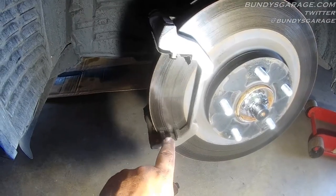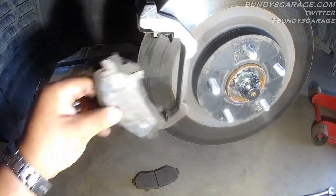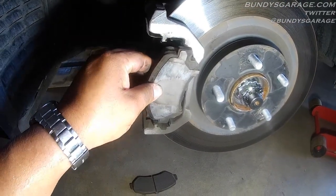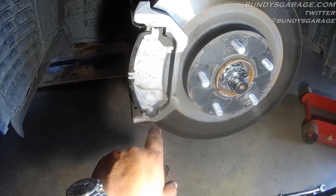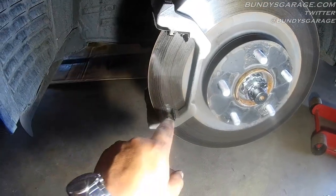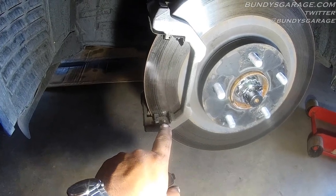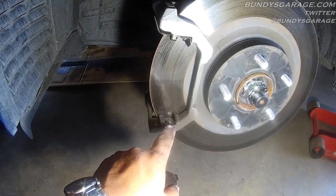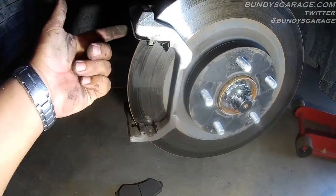Right in here are the slides for the brake pads — the brake pads actually slide right in here. This brake pad actually slides back and forth on this guide. What you want to do is get some brake cleaner, clean that up, and then put some Napa Siliglide — which I'll show you here in a second — and coat here, here, and on the backside as well.